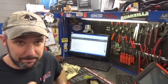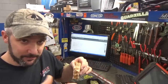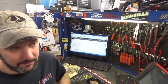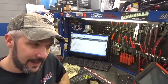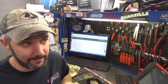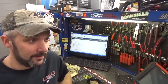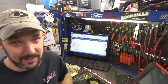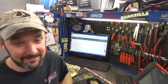The only other thing, there's that big diaper looking unit that goes behind the manifold to the block. Now, I have done some reading online, and they're saying, and I don't know, maybe you guys know because some of you work for Toyota, that it is the root cause, or supposedly one of the causes of these bolts pulling out, overheating that area of the block, causing the bolts to fail. I don't know if that's true, but I do remember that diaper was a pain to get up out of there, and I don't see its purpose. And I'm just gonna leave it out.